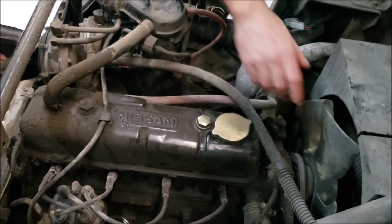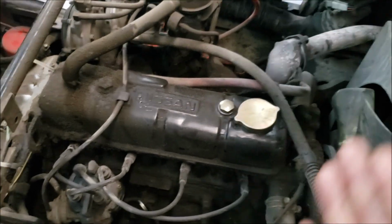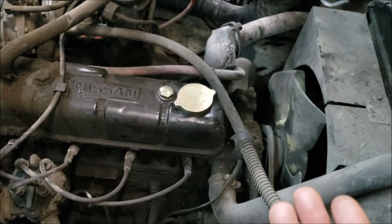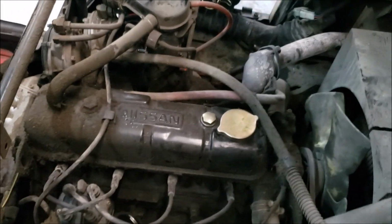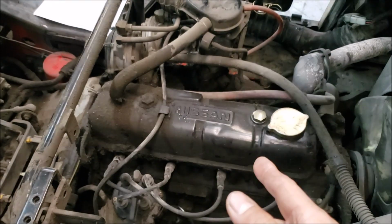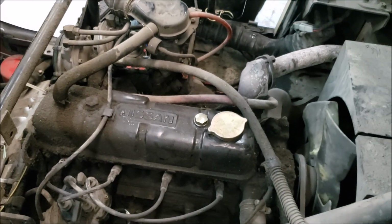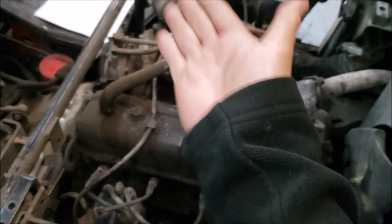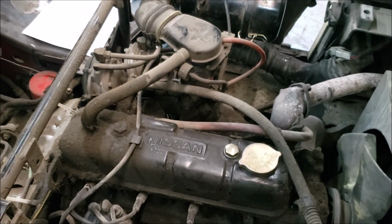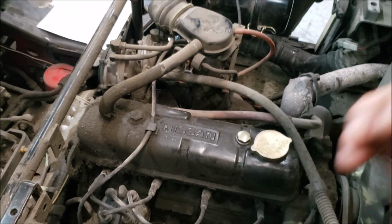If the engine is able to spin, or you're able to move the engine manually, then it makes sense that it may be a starter. Does that make sense? So that is the problem that I see on the report. This may very well be a seized engine, but it's the process of doing the diagnostics to arrive at a seized engine. So from the battery, it should have been not necessarily a starter, but manually. From the battery, that's fine. You crank it.